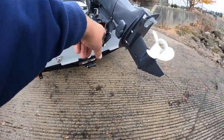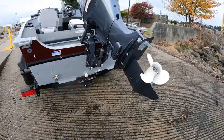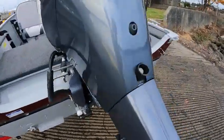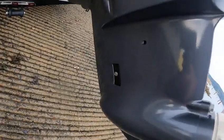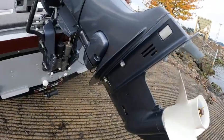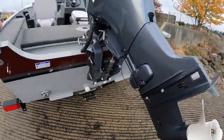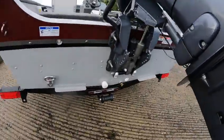Screen — that's for your live well drain plug. That other one's for a drain for the live well. So your oil drains right here. You put your earmuffs or flushers right there, put water to it, then start the motor, then turn the motor off, then turn the water off — always have water go into that — and always have the motor trim down.